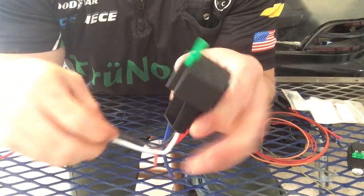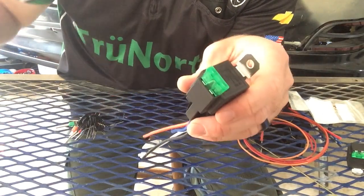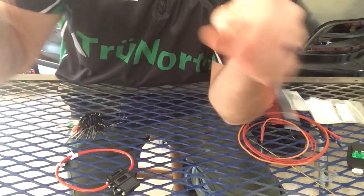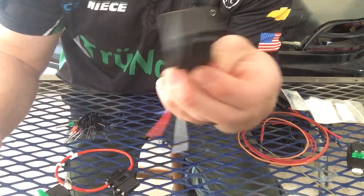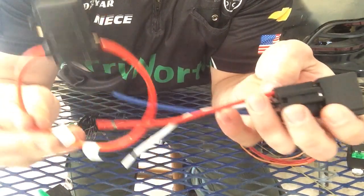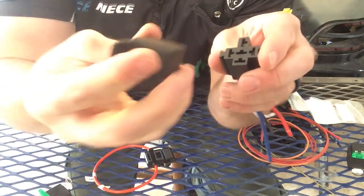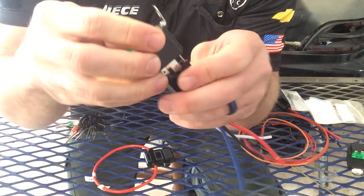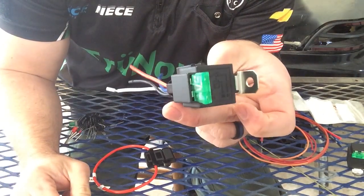You end up with something that looks pretty nice and tidy without the added fun of zip-tying your inline fuses somewhere else on your system. Additionally, this already has a fuse built in. Previously I was lazy and bought an inline fuse I intended to use on my normal relay kit. So instead of getting back into my vehicle and soldering it into the feed line, I simply remove the non-fused relay unit and plug in the fused relay — and that condition is now sorted.